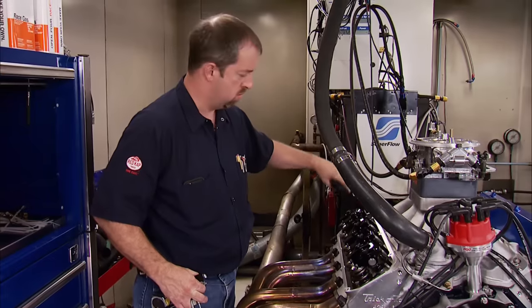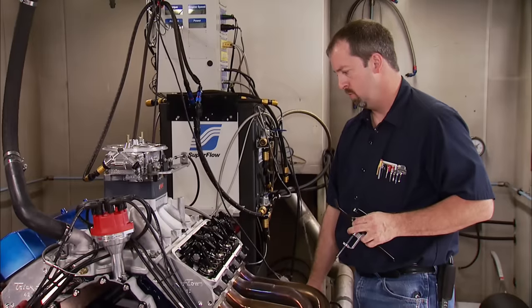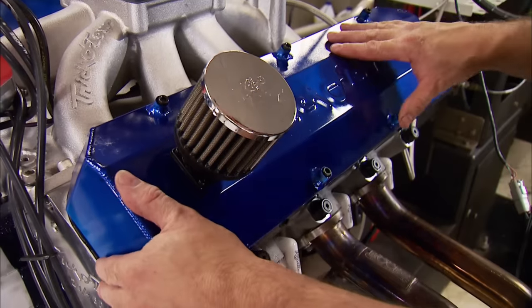Time to lash her up. Here's a quick tip: always set your valve lash at operating temperature, and only take one valve cover off at a time to help maintain the engine's temp. I'm very excited about this.